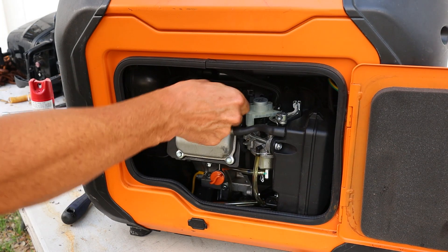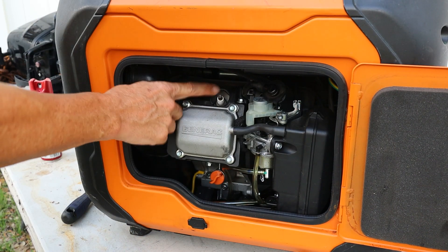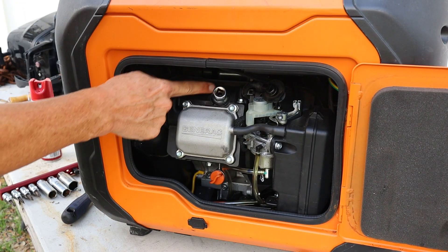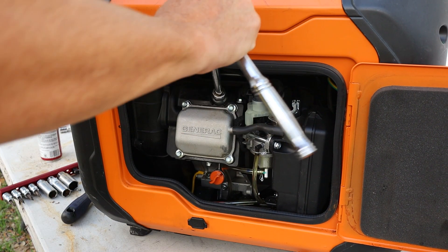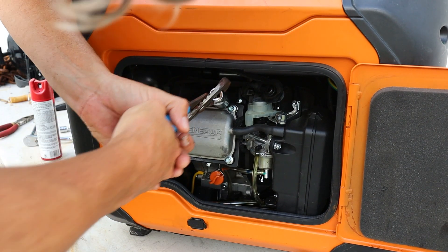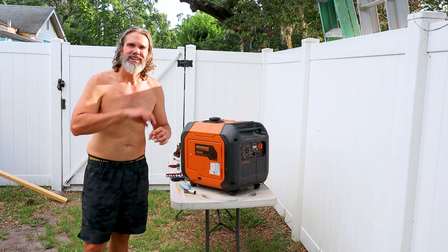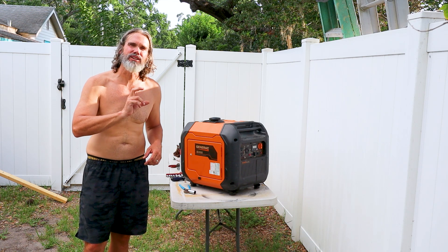Up here is gonna be your plug wire — you pop that off and the spark plug will be under there. Starting off by pulling out our spark plug, I always try to be gentle and give even pressure on all sides of this little boot. It's really short. They do give you a spark plug tool — I'm not sure exactly where it is so I'm going to do it with a conventional spark plug socket. The reason they give you that tool is because this is a really tight clearance right here. You can see why — the clearance is really small on that little opening. Just grab a pair of channel locks and you'll be able to work out your spark plug socket.